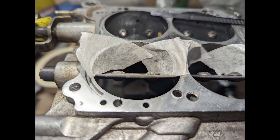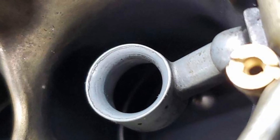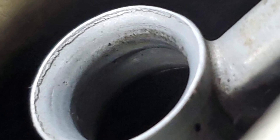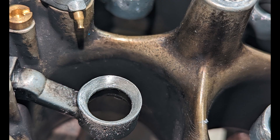Here is a decent shot showing how far I took down the screw head. The other area I wanted to touch up were the boosters — the leading edge has some casting flash. I sharpened all four boosters up with sandpaper using the tip of a finger. The material comes off very easy.